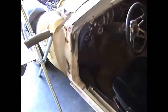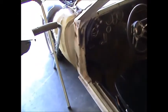I'm probably going to end up knocking this down — I might get the 80 grit out and just knock this down and see what I've got, but I'm going to do it by hand and not with the DA, so I don't have to do too much repair to the body line. We'll do the door first, then we'll start stripping and taking care of the jams. The door's going to have most of the work — the jam is just cleanup more or less.